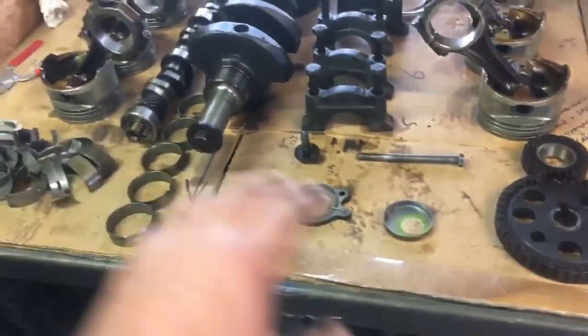Anyway, get temptation out of the way — throw away the bad stuff and get yourself ready to use good stuff. Let's talk about cylinder heads. This engine came with some pretty good cylinder heads already. They're not aluminum, not high performance, not fancy heads, but they're about the best cast iron heads that Ford had on a 302/5.0 family towards the end of its lifetime. This engine I picked up out of a '96 Explorer for $350 out of a junkyard was supposed to be the Cobra motor of the Mustang — they phased it out and went to the 4.6. So I got the better heads. This is a budget build, and we're trying to make a high-performance, long-life, reliable budget build — that's the whole goal for this engine.